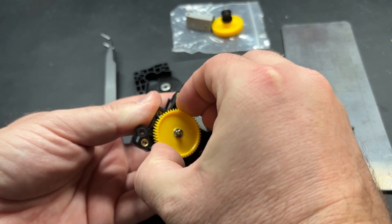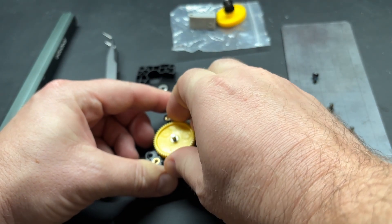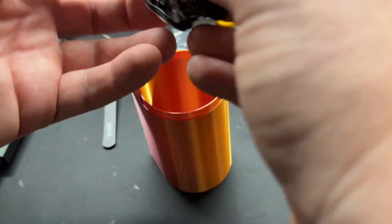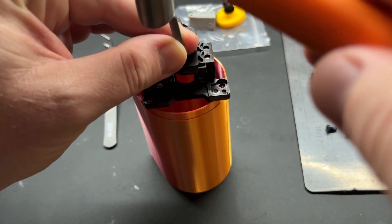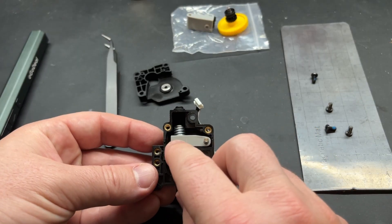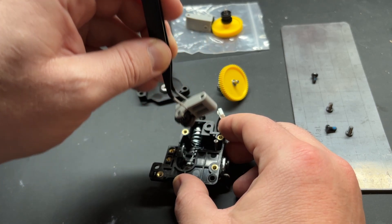Just don't remove this screw completely. With the spring no longer under pressure, we should be able to remove the driven gear — it may be really stuck. If it is stuck, get some object you can put the extruder gear on and then tap it out from the other side. With the driven gear released, we can remove the active gear — this is where tweezers come in handy — so just carefully remove it and put it aside.